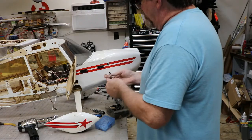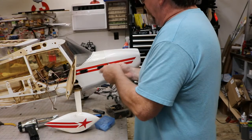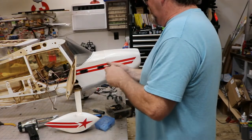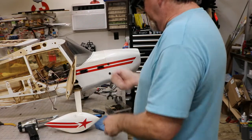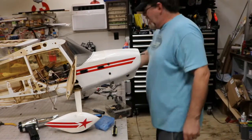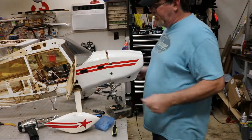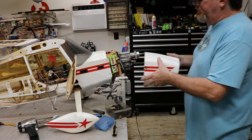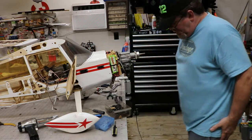With those big twins, 100s, 150s, even though they've got those six bolts on there, man, you can have one of them just loose, and it will start a chain reaction. I'd love to have that on high speed camera and watch what actually happens, because it pulled three of them out and sheared the rest of them off. All right.